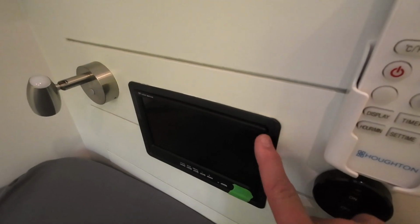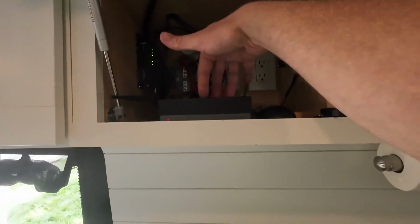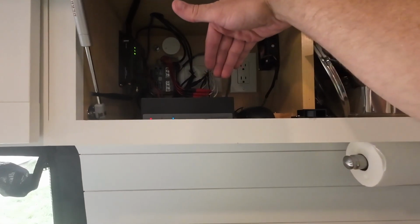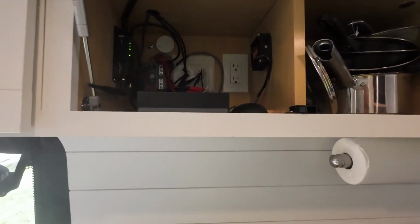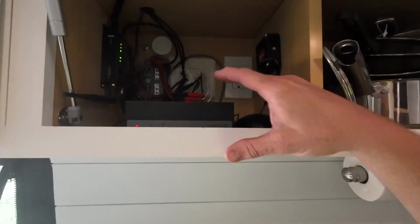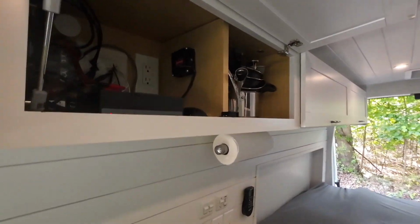So again, this was a composite video feed that I used on the conversion. I misspoke a minute ago when I said this has a composite video output. What it has is the HDMI, and I just use an HDMI to composite video converter to power that small monitor there. But you could do it the other way. You could run HDMI to your TV and have a VGA to composite converter for a little monitor like that. But again, I'll have links for all this stuff in the description.